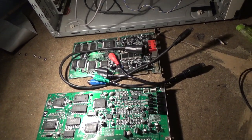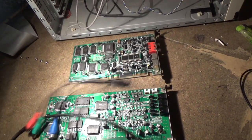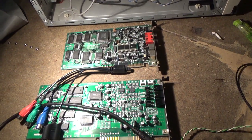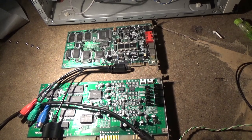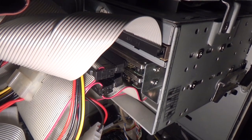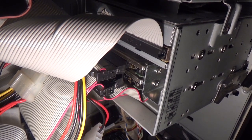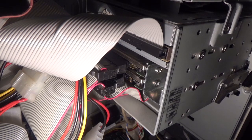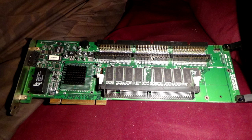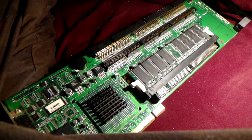Nonetheless, more on topic. Yeah, I don't know why people have this aversion to populating these stinking headers. Just an endless annoyance. I suppose I should mention that those IDE laptop drives are 20GB 5400 RPM drives made by Fujitsu. Originally there were 6 and they would have used the Promise SX6000. But the problem is, Promise were making really crappy products when this card hit the shelves, and it's slower than just using the drives on their own with the Intel 440BX chipsets